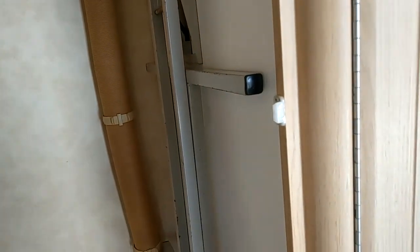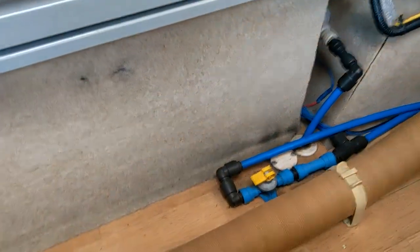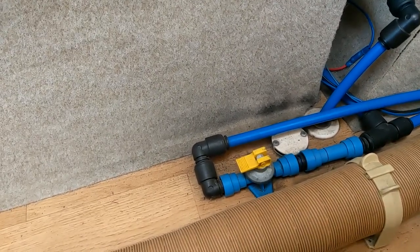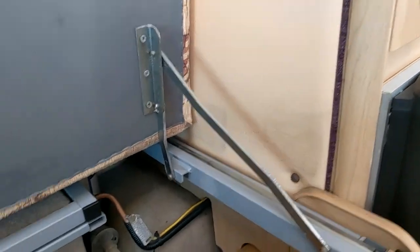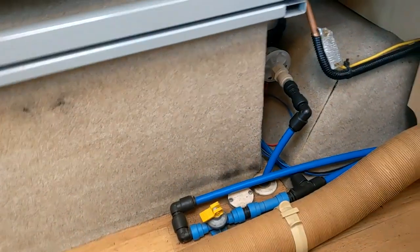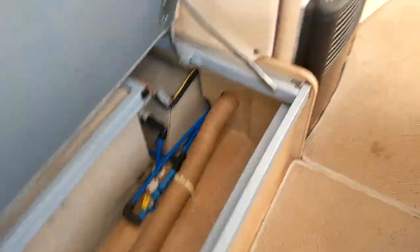You've also got your table in there. That seat is now up — and what you'll find down here is this little yellow switch. We've shown you how to empty the cold water from the freshwater tank; this is how to empty the hot water tank. Pop that up and you can hear the water flowing — that lets the water at the bottom of this cupboard behind the fire drain out of the boiler and dump it out the bottom of the van. For draining down for winter, that needs to be vertical, facing up, to let the water out. A lot of people forget to put that back, which means when they fill the van with water in spring and turn the water pump on, it pumps into the boiler and straight out the bottom of the van, and folk get a bit of a panic.